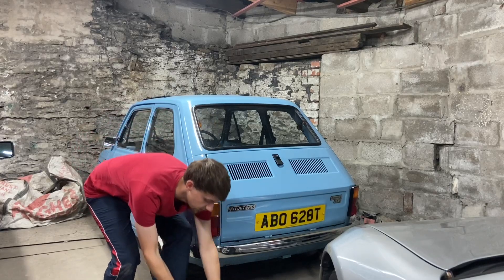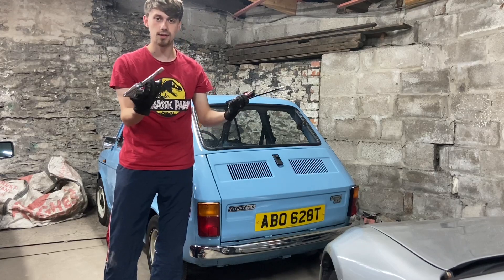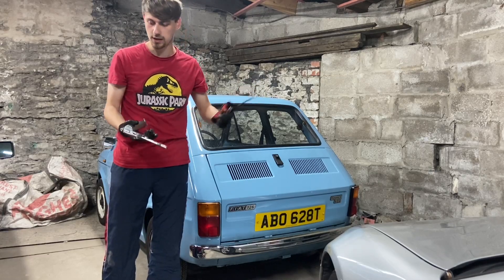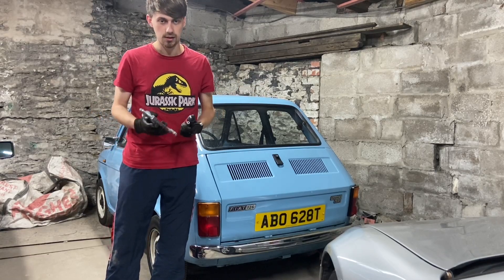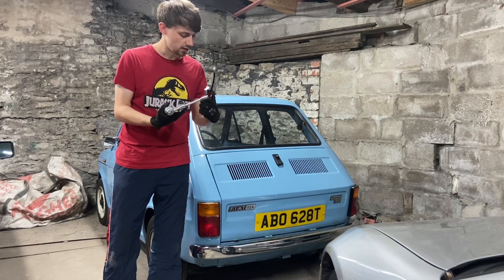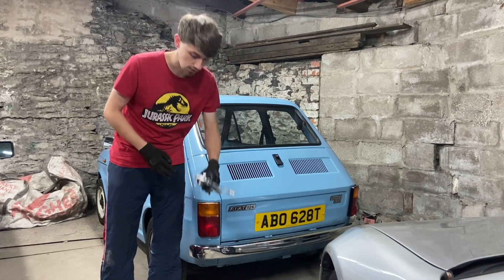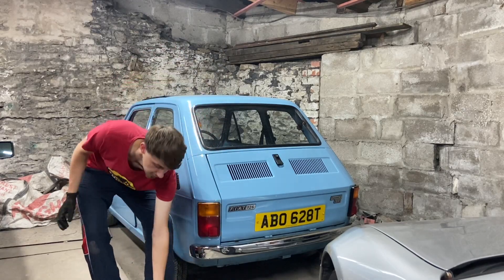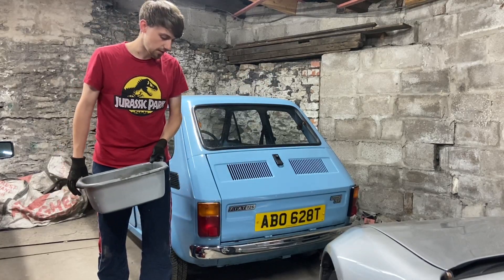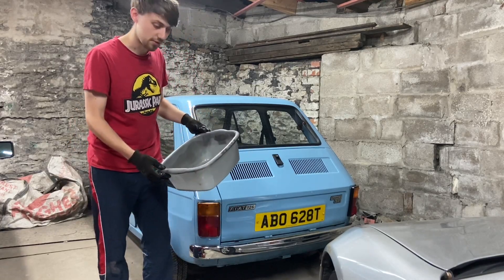So I bought this — it's a Nielsen 3oz grease gun cartridge set. It costs about £14 and you can get bigger ones, which is ideal if you're going to be greasing things fairly often — especially with the MG Metro I bought, where the rear arms and stuff like that it's useful for. I just thought it'd be an entry-level thing to try out. We've got a bit of tight steering so we're going to grease the kingpins and hope for the best on that.